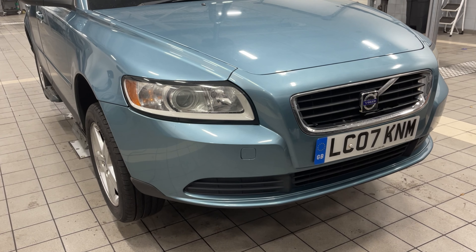Whilst the oil is draining we can move on to the oil filter. These aren't usually done up that tight but mine was, so I used a large set of grips to help me undo the old filter. Once you've removed it, clean up as much of the used engine oil as you can from the surface where the new filter would go on. Then you'll need to coat the seal of the new filter with fresh engine oil before refitting it.